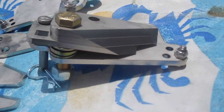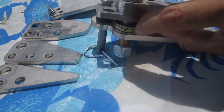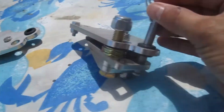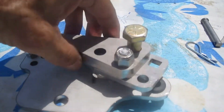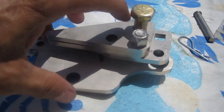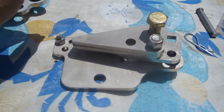When you assemble this, it's going to look like this. This plate bolts to the spring, these plates go in between, and then you put washers here to make up the difference for the thickness of the spring, because this section has to be able to slide. By pulling this pin out, it allows the bracket to swivel. When you're not using it, it stays in one position, and when you need it you tilt it into the active position — you can do that with a three-eighths ratchet and extension, just stick it in and turn, and it'll swing underneath the spring to give you the support.